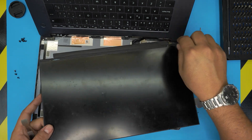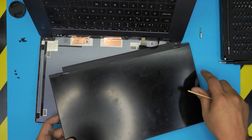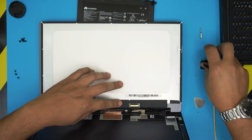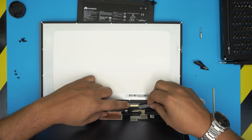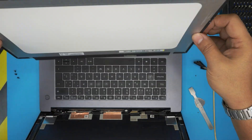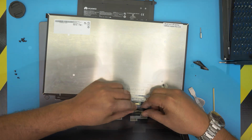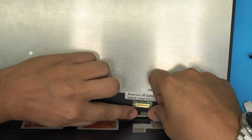Pull the flex cable out a little so you have more room to work. Flip the LCD face-down. There's a lock on top of the connector — lift the lock up and slide the cable back out. That's the old one out. Grab the new LCD, place it face-down the same way, and slide the cable straight into the connector, making sure it goes all the way in.